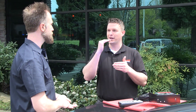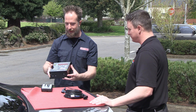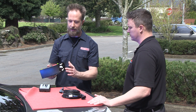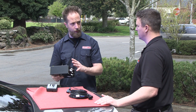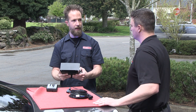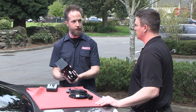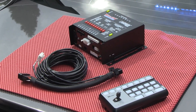Carbide has a bigger processing system and you can take advantage of basically plug-in WeCan-based devices - light bar, rear inner edge, front inner edge, WeCan expansion module - and everything syncs through the Carbide. So overhead is matching the rear, traffic advisor color displays, flash patterns, TAs are linked up. The takedown feature is really cool on this car too - when you go high beams, not only does the external light bar sync up but so does the inner edge. As far as the footprint and power distribution electronics, this is the same casing size as the Sapphire - a direct replacement size-wise.